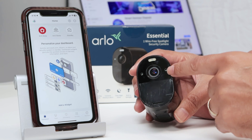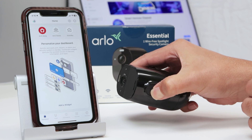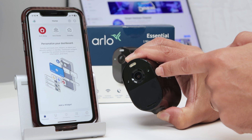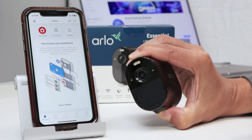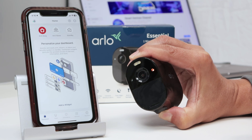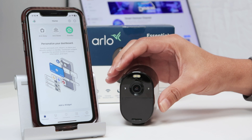You have an LED here to indicate that the camera is being reset. So I press here and hold, and I just keep waiting for this LED to change color. It's supposed to blink in amber color. Here we go — it starts blinking amber like this. So you let it go and you're good to go. Now it's resetting.